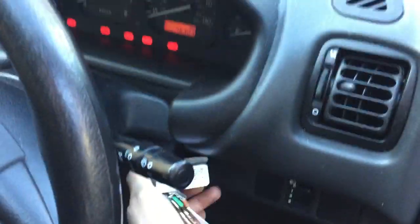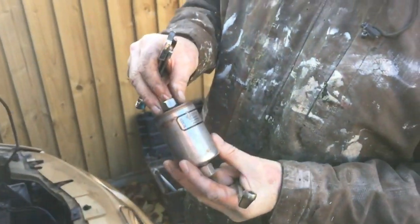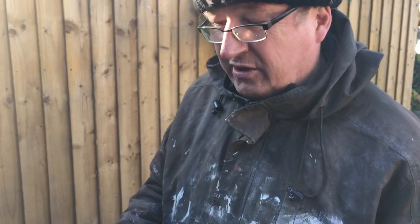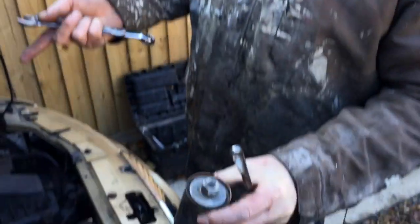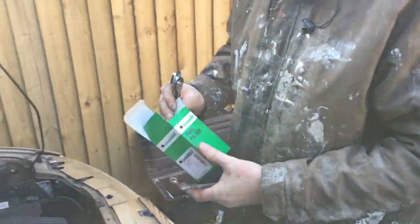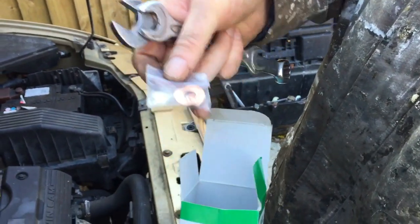The longest part was an experiment we did — when I initially loosened the old filter there was a little fuel coming out, so we undid it again to see how much fuel came out and it was substantially more, which means they do actually get blocked and it's worth replacing. The car sounds a lot better and more responsive. This is just under 70,000 miles but definitely worth replacing. You can get this from Euro Car Parts — the Crossland fuel filter — it's about three pounds.